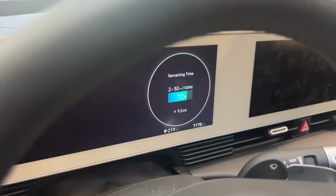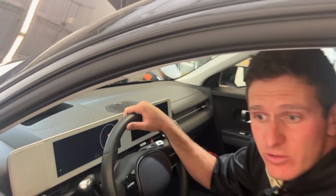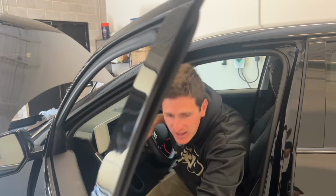Now, when you're dealing with these big, chunky 48 amp chargers, right, a lot of the times, especially if you're looking at an older EV, they can actually have the potential to deliver more energy to the car than the car can accept. So like Nathan's Leaf, he has a first gen Leaf, I think that only had like a 6 kilowatt onboard charger. So jumping up to 48 amps doesn't make a huge difference because it can only take 6 in at the most.